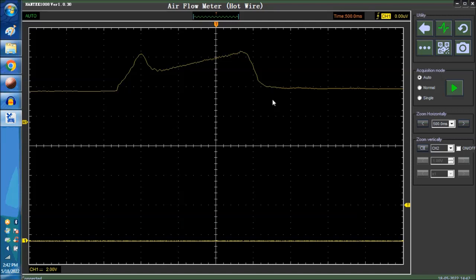Back to the video — basically what you're looking for is the reflex of the hot wire mass air flow sensor. The hot wire mass air flow sensor, exactly as the name implies, it's a hot wire. It's made out of platinum. So it's a little tiny wire made out of platinum, and basically there's a little circuit inside that looks at the current needed to maintain a specific voltage or temperature across that wire — that's why it's called hot wire.